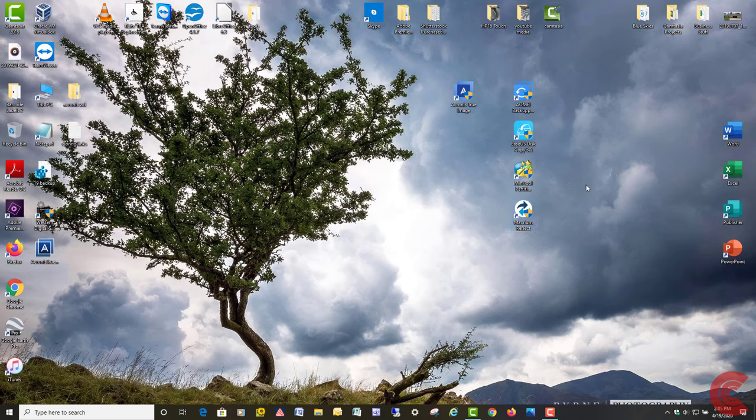I checked it out. The interface is a little confusing if you're a beginner and you're only doing this once for the first time. If you're willing to spend the money on a new solid state drive, if you pay $39, you can get the unlimited version of the Acronis True Image. I just find it by far to be the most reliable one. And 9 times out of 10, once it begins the cloning process, it'll restart your computer automatically, then boot into a pre-Windows environment and do the cloning process without Windows even loading or running, and it goes much quicker and a lot less chance of anything going wrong.